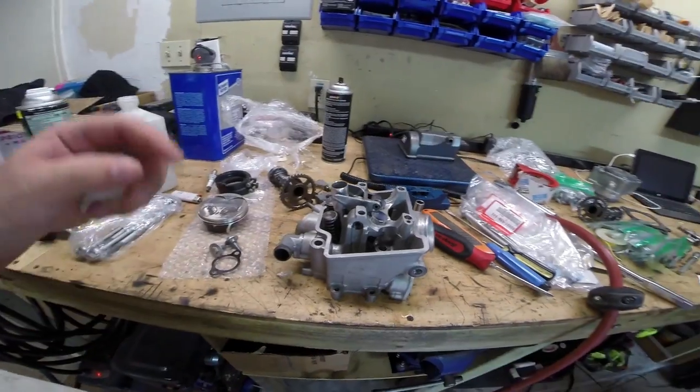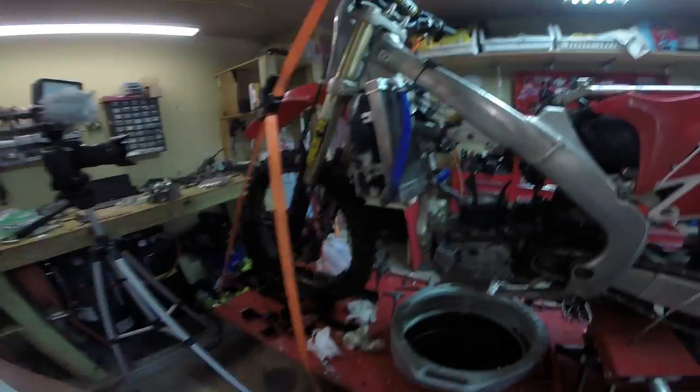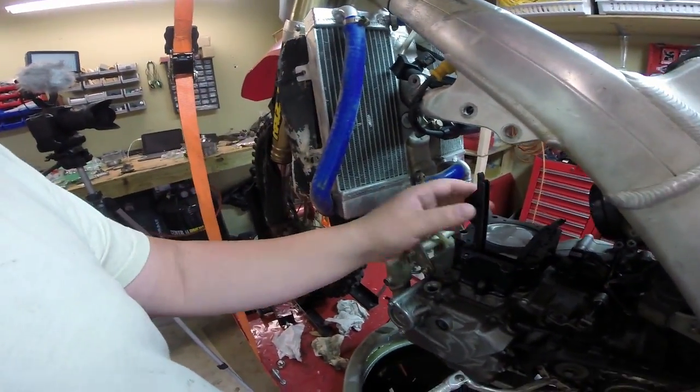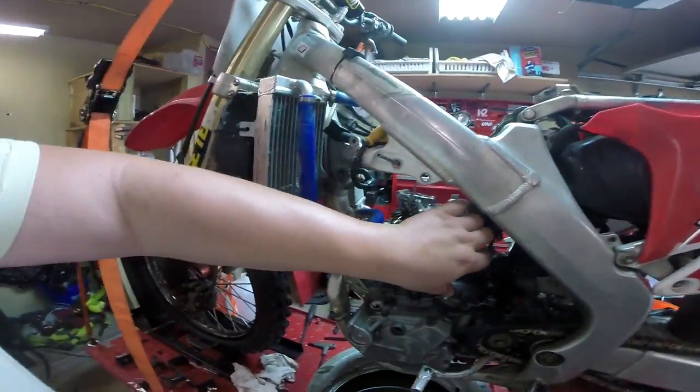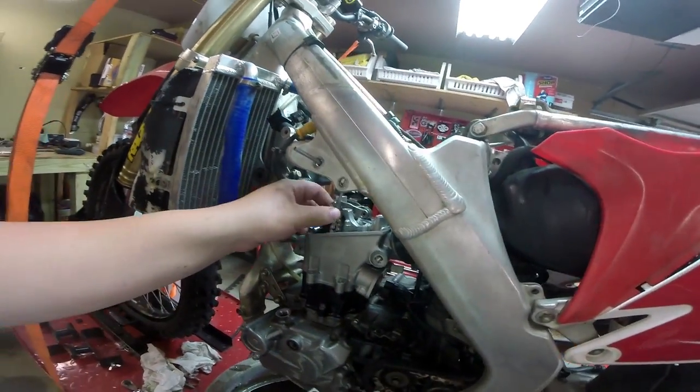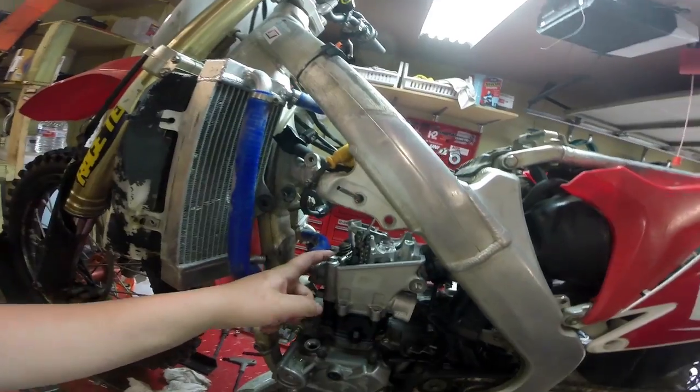So the next step is we can put down our head gasket, put in our new head bolts — since they're one-time use — and start torquing everything down. From here it's basically just a marathon to put everything back together. The hardest thing is going to be locating the head and making sure it lines up with the intake. One thing to keep in mind is before you install the head gasket, you need to install this — it's your second timing chain tensioner, it actually slips in under there. The head went on without too much fuss. I'm not a big 'you must torque everything to spec' proponent, but head bolts are just one of those things that you absolutely, positively have to torque to spec, otherwise you're just not going to have a real good time.